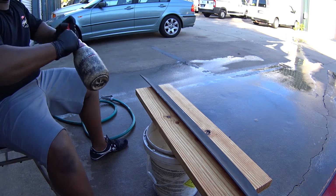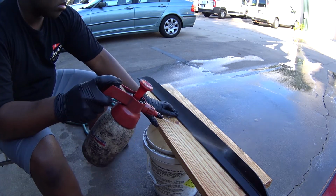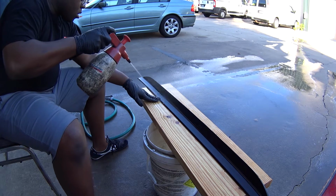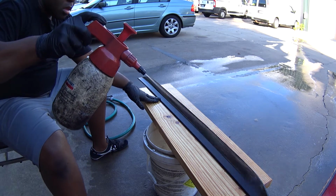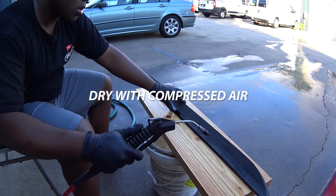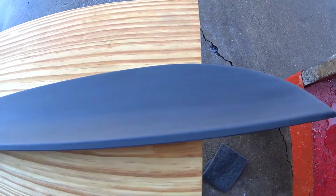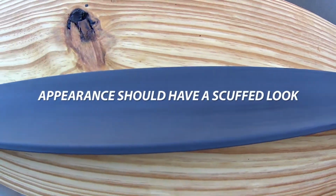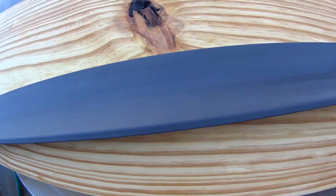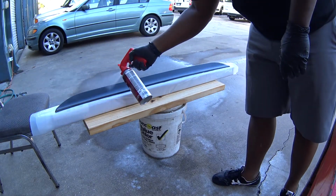Here I'm applying an alcohol-based cleaner to dry out the spoiler. This is one of the final steps before the base coat application. What all this does is remove any mold-release agents and waxes from the part. If you don't remove it, the paint simply won't stick. Before the base coat, you can see me applying an adhesion promoter to the spoiler. This should help the base coat lay on more evenly and stick better.